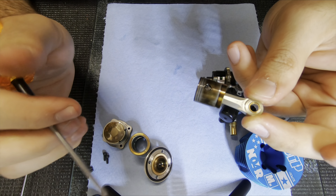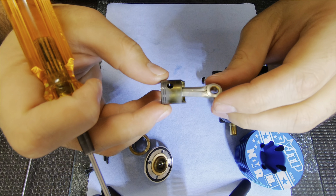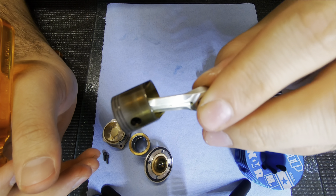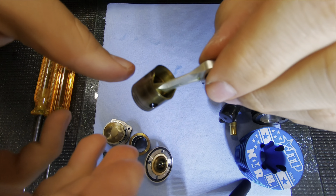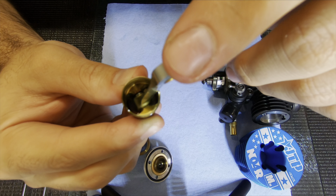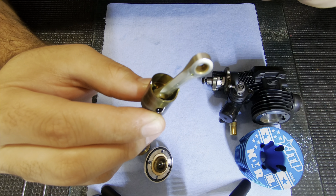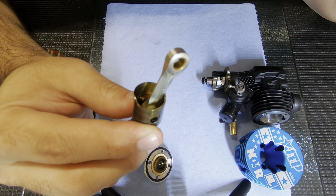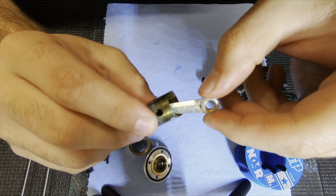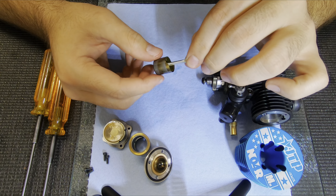This is kind of what I look for with fuel — I'm very meticulous about engine internals when I run nitro. The blowby is doing what I need it to do going around the track. You have a nice burn pattern all the way around. It's still building up — it's only a little over a gallon — but already an extremely nice color pattern. The inside of the piston has a really nice bronze golden coating on all the internal parts. That cross pin going through the inside of the piston is getting good lubrication, and all the internal parts are nicely coated, so if it sits for a prolonged period you have that protection from the oil package.